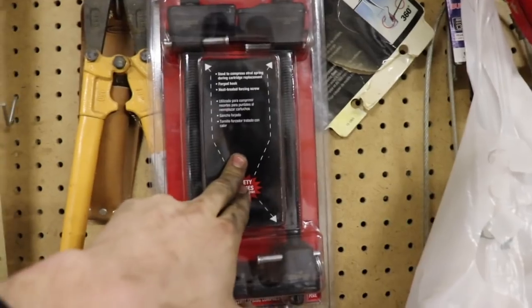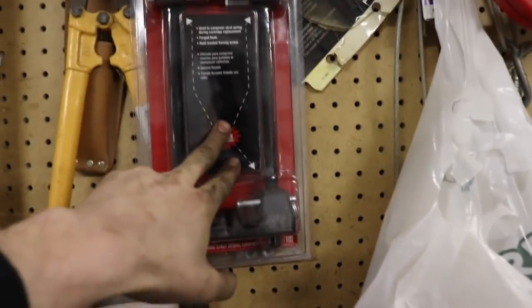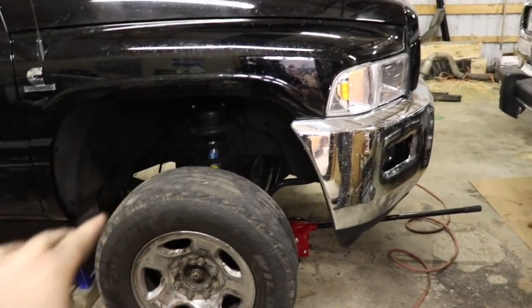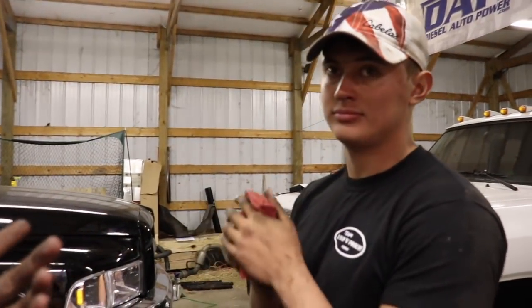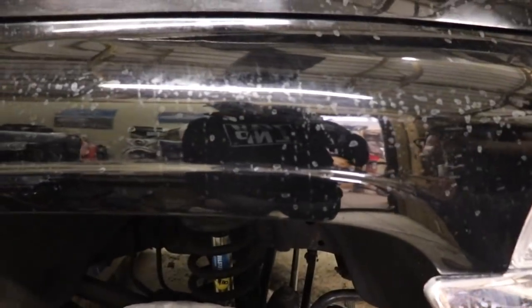But we made it work with the spring compressors. By the way, I bought these today — best 35 bucks I've spent. AutoZone had these OEM McPherson strut spring compressors. I'm not sure if they're technically rated for a truck like this with these heavy duty coils, but they saved so much time. Without those, we would have had to take off the upper and lower control arm, disconnect a bunch of wires, cords, and all kinds of extra stuff to get it low enough to get the spacer and spring back in with an extra two and a half inches. That would have been a pain. There were a couple things that caught us up — a rusty bolt, a bolt that wouldn't line up — just small stuff. But overall the project wasn't too bad and it saved me like 500 bucks.